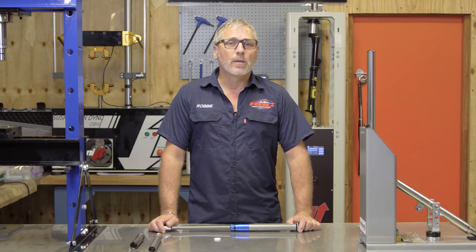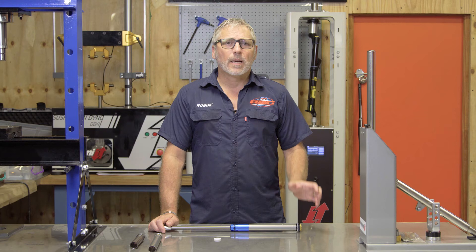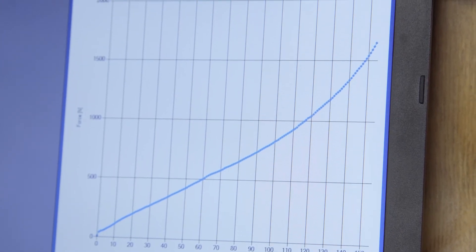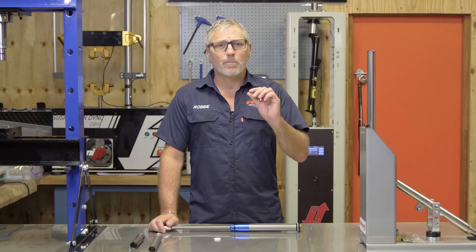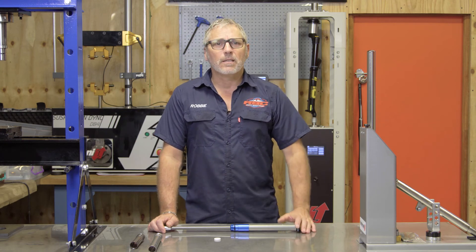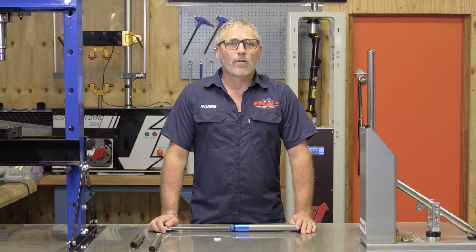For today's test, we're going to use the Andreani DS1 — it's the air spring dyno. It will do three things: it will show me the initial stiction on the damper, then it will show me the air spring curve, and finally it will show me the last bit of the bottom out, which is the rubber bumper at the end. That complete cycle is the full spring curve of a fork or a rear shock, especially with the air side, because the air side has a very different feel to a coil spring. Understanding that with the DS1 makes it much easier to understand and visualize.